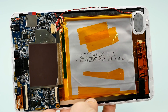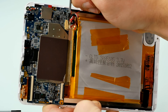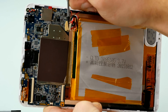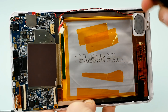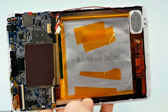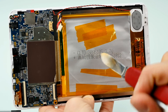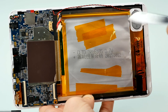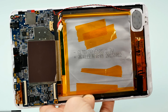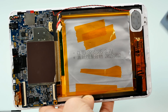Now let's get out the battery. The connector is here, so you just grab a screwdriver and pull out the connector — there we go. Now, to remove the battery itself, you shouldn't use a knife. If there's any charge in the battery and you poke the cells, it can cause a massive fire — it'll bloat up. As you may have seen in my other videos, it's a serious hazard.